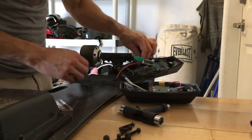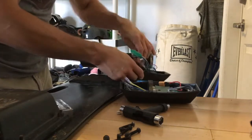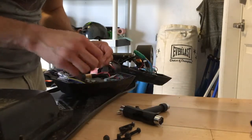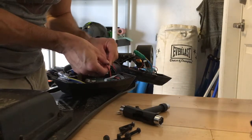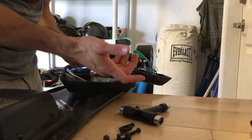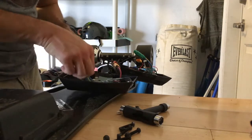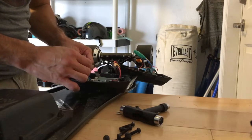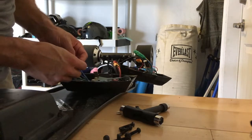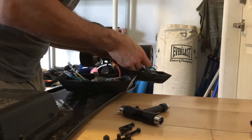Now what we're going to do is unplug the cord for the battery — this should basically directly plug in to the battery port on the new ESC, simple enough. From there, all we really have to do is plug each hub motor into each one of these ports. We just have to undo the tape on the old one first.